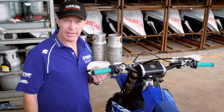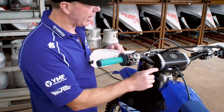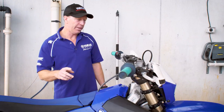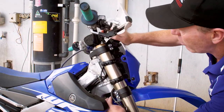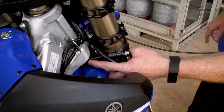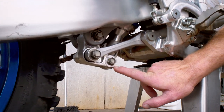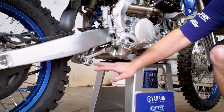When using a pressure cleaner to clean your bike, there are a few things you should avoid. One is a crossbar pad — they're foam, and this one here has been eaten away by someone misusing the pressure washer. Another thing to avoid is aiming your pressure washer at bearing points — so steering head bearings, top and bottom. Just avoid squirting it directly in there. Same around suspension linkages down here — just avoid holding it on at that point. You can pressure wash, but just avoid direct pressure on it.